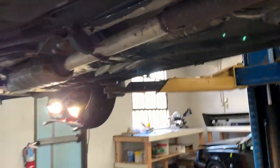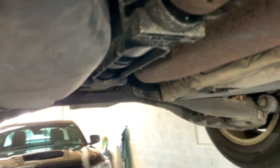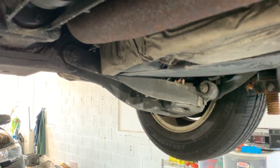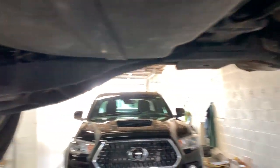This car didn't come with a driveshaft — someone converted it to front-wheel drive — but that means I got it cheaper. The angle gear works fine; it spins with no problems and there's not a lot of excessive backlash. The rear end works fine too. I tested all this stuff before I bought it, so you can see the rear spins with no problems.